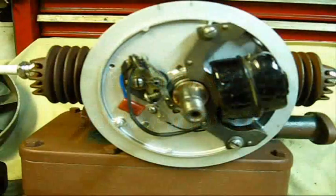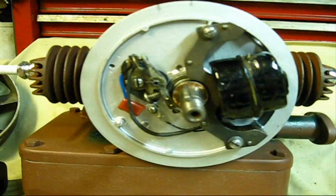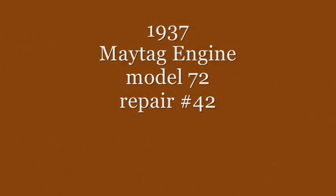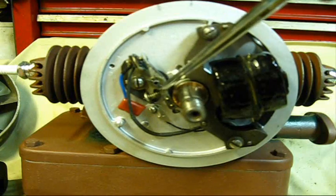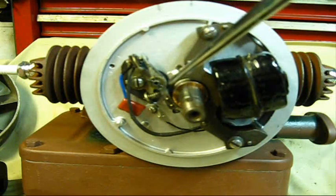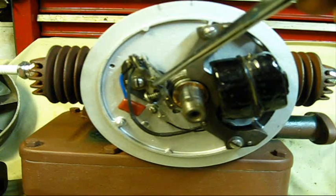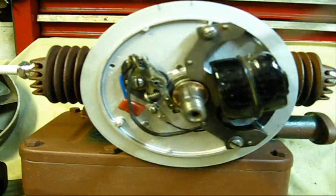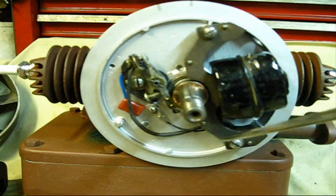To tell you something that, as a Maytag mechanic, you would not need to know: on this twin cylinder, if you remember, on this backing plate right here, this stud that's sticking out — mounted onto that stationary backing plate, the stud is permanently fixed. There is no adjustment in the timing of a Maytag twin, a multimotor. It's a fixed system.